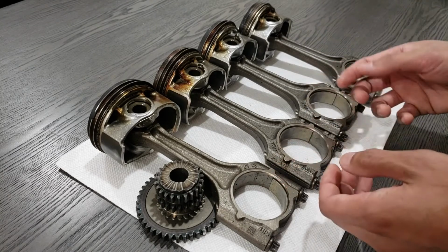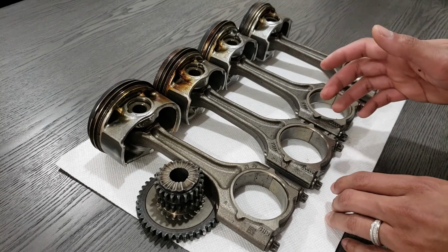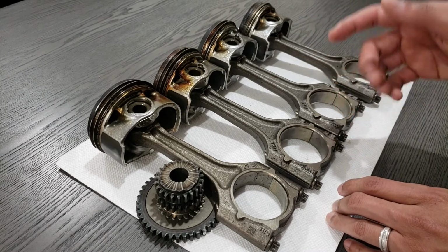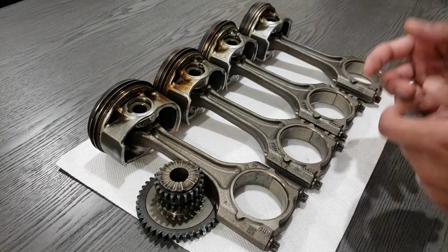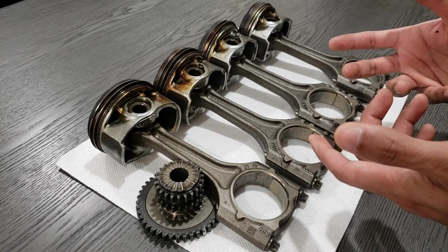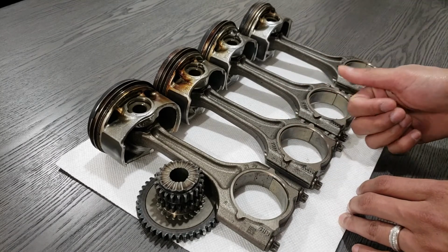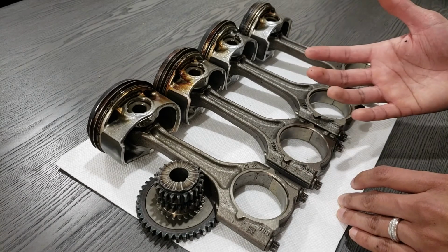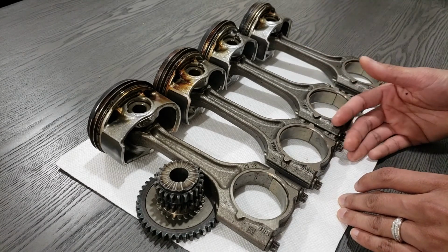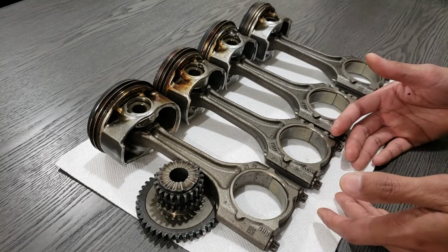Basically guys, I already explained the benefits of the E85. Now, some of the things that I didn't know at the time. With E85, you need to flow about 35% more volume compared to regular gasoline in order to achieve complete combustion. In my case, I put in 10 liters and then filled the tank up with 94, and I think maybe that was just way too much E85 in the fuel system.